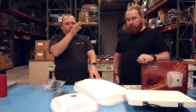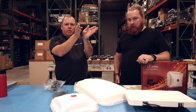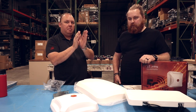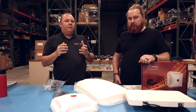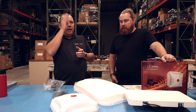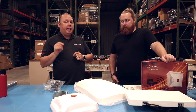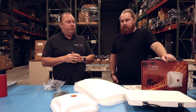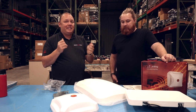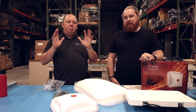Directional antennas — think of it like a laser beam to that cell tower. Depending on the specifics of the antenna, usually about 15 degrees of hyper-focused gain where it's going to be able to travel a lot further to reach that cell tower, but it's going to be in one direction. Directional antennas are really popular for folks that are super fringe or that just have one cell tower or cell provider. If you can dial in the best signal possible, that can — not always, but can — result in higher and faster download and upload speeds. You're still going to be at the mercy of that cell tower; you could have perfect signal to a tower, but if that tower is saturated or running DSL, you've got great connection to the tower but nothing out to the internet.